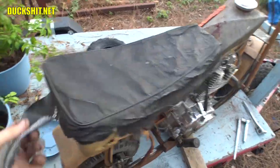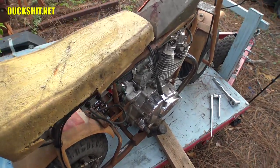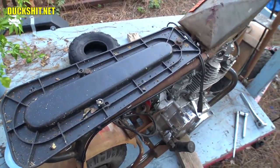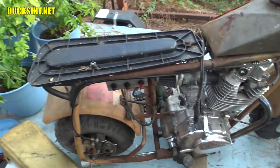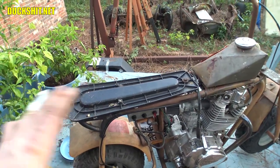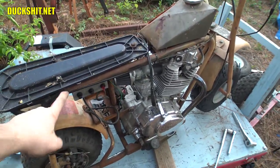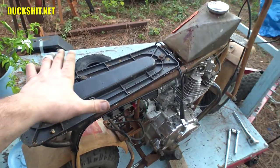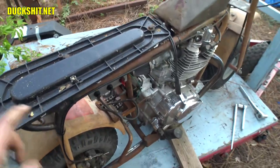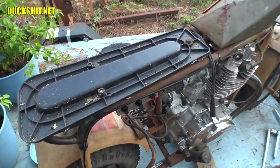Next on the list is this seat — it's just falling apart, the wrapping became incredibly brittle and is falling apart. The foam, however, is in decent shape and can be salvaged and reused. The base plate is also in pretty good shape, though it's got all kinds of holes drilled in it from all the different ways it was attempted to be mounted. I'm not going to buy a new seat — they're anywhere between 50 and 70 dollars, way too much. Instead, I'm going to unbolt it, weld or bolt on some little hinges to the side, and make the seat flip open with a clasp. That way I can get to the electrics without unbolting everything.